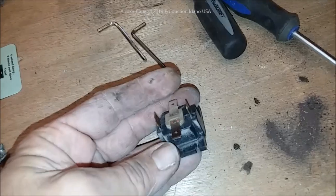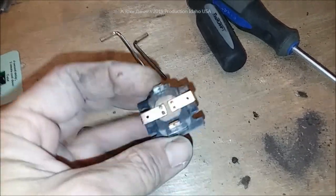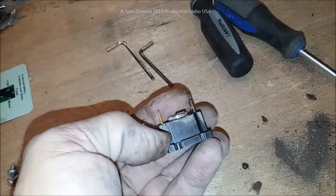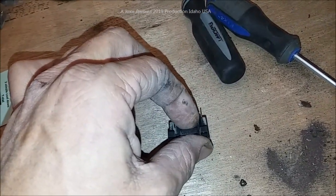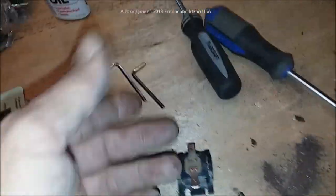Here is the item — it is the run heat fan control relay. What they do is they have a little bi-metal strip inside. It heats up when power is applied, causing it to expand against the contact points and send power through to the blower when the blower activates.